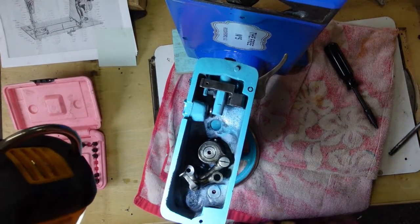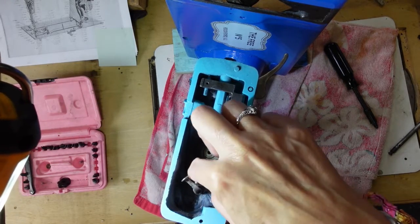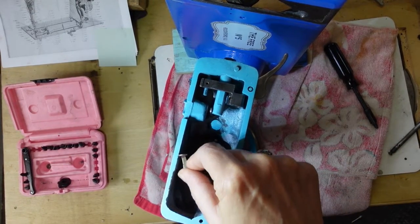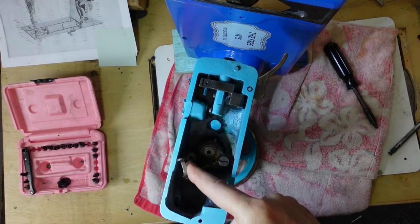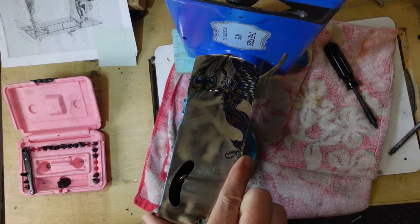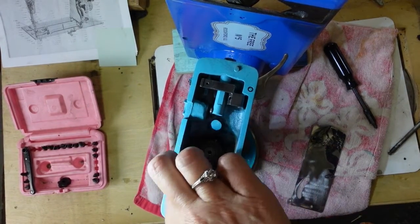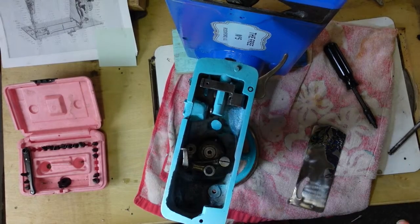Hello and welcome to the next day — my battery died on me last night right when I was putting this screw in. I just wanted to show you this little three-toed chicken foot looking piece. I've screwed it back on here and this is a reverse threaded screw, so you know, lefty tighty. And this thread take-up lever — at first I thought, oh my gosh, what has gone wrong? But it's actually supposed to move in a curved motion. When I grab the plate, you can see the little slot for it is cut out in that curved position. It looks like I have something in the wrong spot, but anyway it's supposed to actually move curved, so that's kind of interesting.